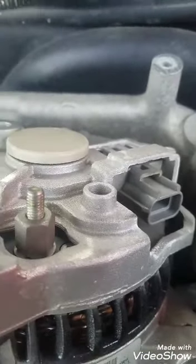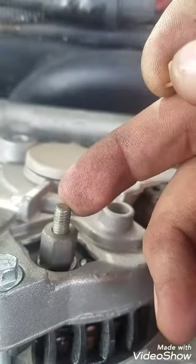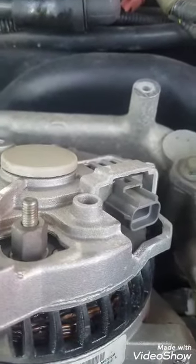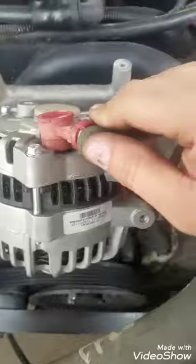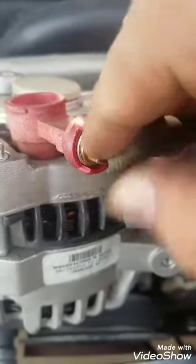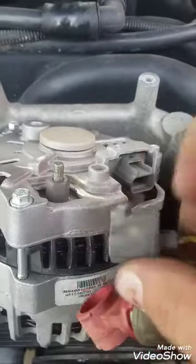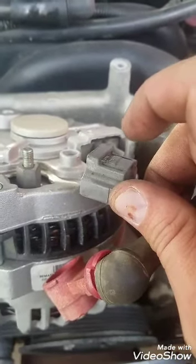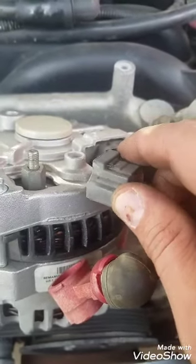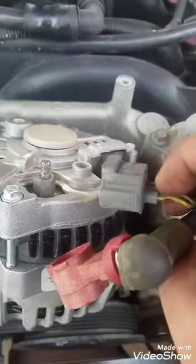This is the back of the alternator on the 2004 Ford Mustang. This is a 10 millimeter nut that goes on this positive post from the battery. And I thought the nut that went right there was actually a 12, and I was wrong — that's a 10. This is the battery cable that goes on there like that. There's also another nut here, but I just took it off the backside like that. After removing the nut, this cable is just a push-connect. If it doesn't come out very good, what you want to do is push on this with a flat blade screwdriver and wiggle it. Don't pull on the wires — try to pull on the housing. Pulling on the wires can make the connection loose and give you a lot of problems down the road.